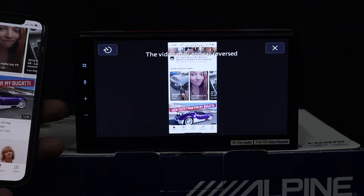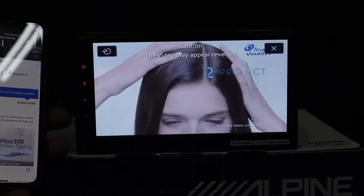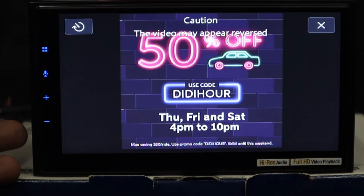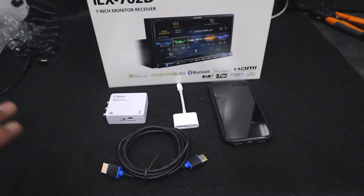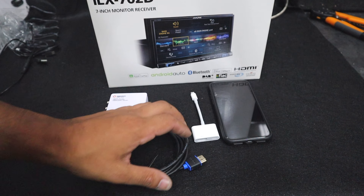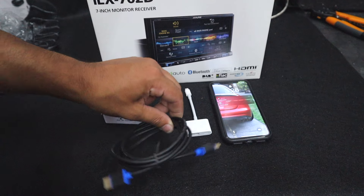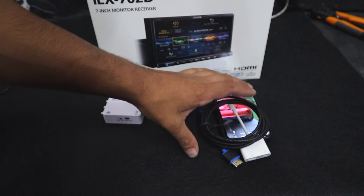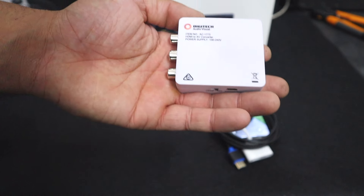It's playing something and you can watch. On camera it looks pretty good, but in real life the HDMI input from the Alpine unit looks ten times better — it's just because we're using this composite converter, so it's not ideal, but it's still pretty cool. Just to go over the parts again: you've got your device — Apple or Android, doesn't matter. You need something from USB-C or Lightning to HDMI, whether it's a cable or an adapter. Then you need your HDMI cable, which can either plug directly into your head unit, or if your head unit doesn't have an HDMI input, you get one of these — an HDMI-to-composite converter.